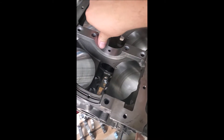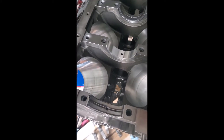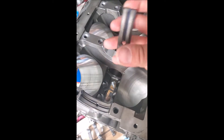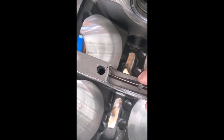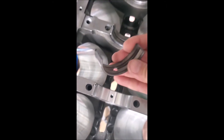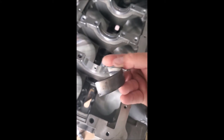The way these go is: you get the spacer first and you line it up just as you would the other ones, then you slide it in just like your other bearings. These are just taking up the room, and then you just set your other bearings right on top. They've got a notch to mate with the regular 350 mains.